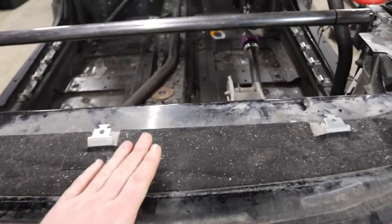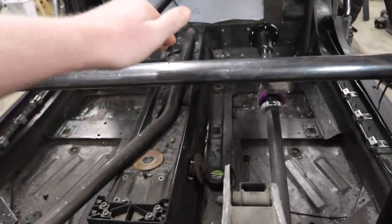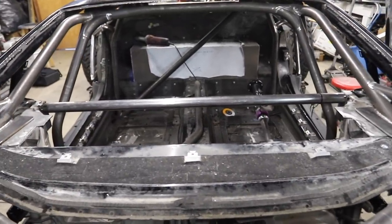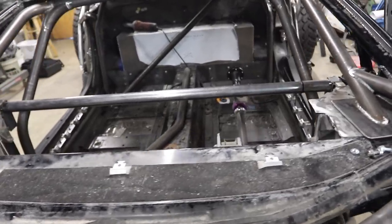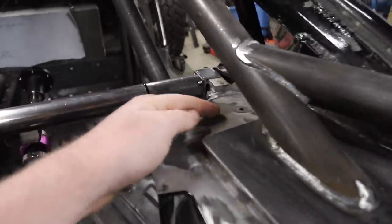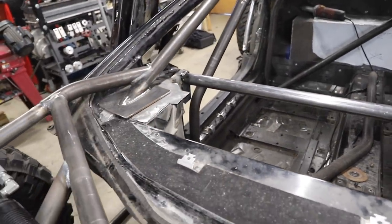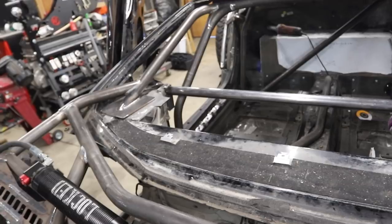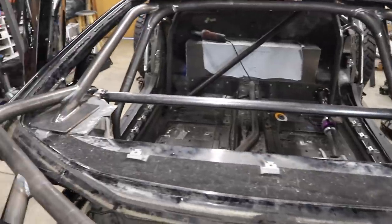Back in the real world - we figured out how we want to do the dash. It's basically from this edge, going flat as a single piece filling up the width of this area from this bar to this bar, going flat across, and then right about here it's going to pitch down and connect in with that bar there. Nice, simple, clean - it should hide the edge as well. We got to build a structure from that high point, welding in a piece of round tube that'll have some brackets that can bolt in, because that's aluminum so we can't weld steel to it.